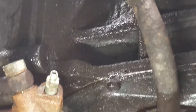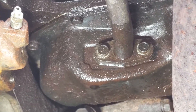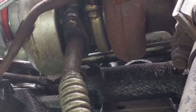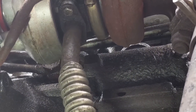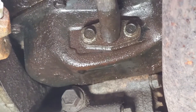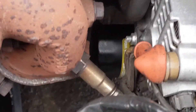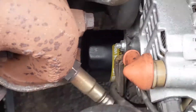What we're going to do is drain our oil first, pull our filter off, then come back over here once we get the plug put back in and the new filter installed. We're going to take out the two 10mm bolts at the oil pan and the two 10mm bolts up at the turbo and pull that oil return line out. We want to compare the holes on the flange up at the turbo to the new one from the 2G - mind you it is an MHI drain, a Mitsubishi drain, and the other one is a Garrett-style drain.